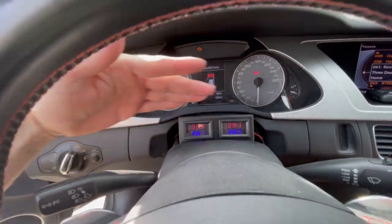We're going to be doing quarter mile testing to see if this actually works. One of the main things we want to try and prove — I don't know if we can do this with temp sensors — is to see if the fluid does one full lap in the system during a quarter mile. You've got 10, 11, 12 second cars depending on your mods, but does it take — or how long does it take for that fluid to get through the system? Does it take 20 seconds to do a full lap? And does playing with the actual pump speed change things for better or for worse? Does intake air temperature improve when running pumps at 100% speed versus factory duty of 40 or 60%? Those are things we're going to try and prove.